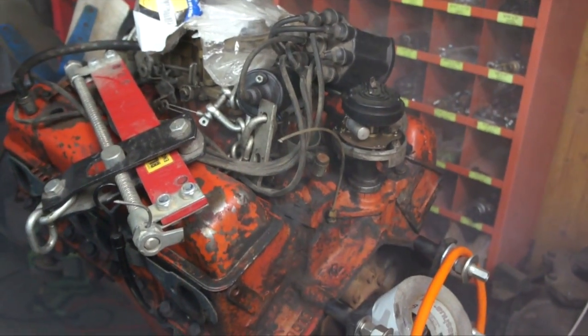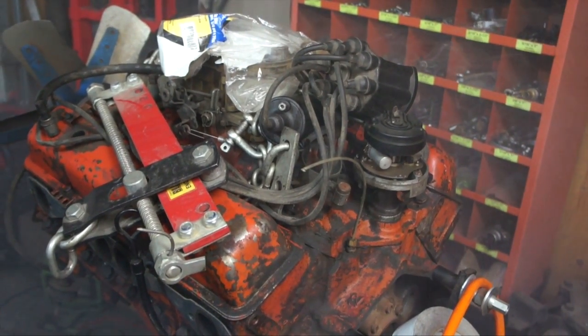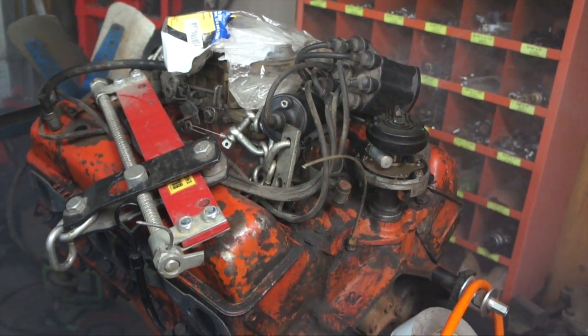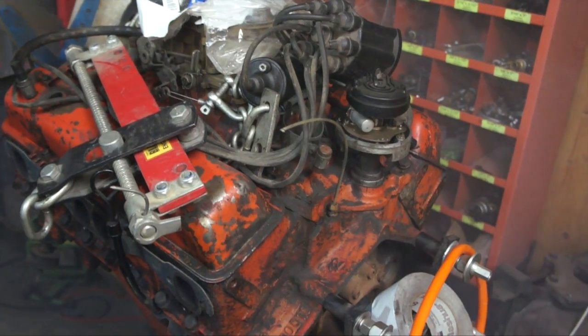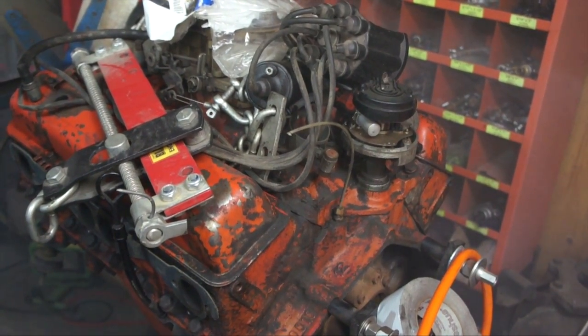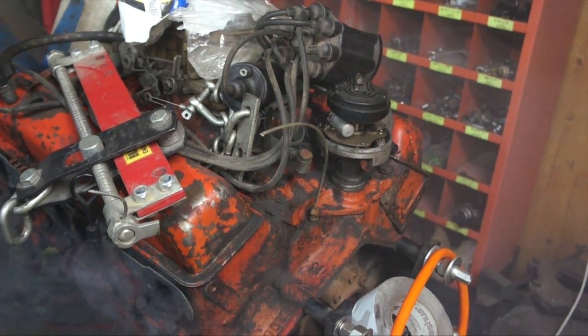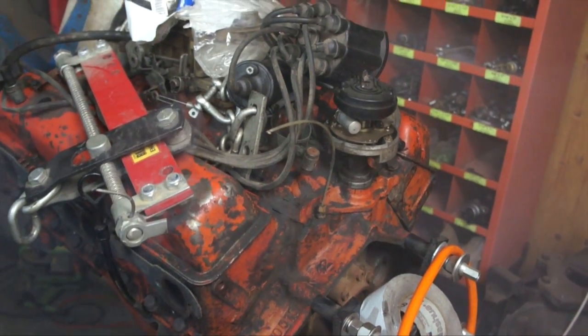This came in handy when I was working on my BMW E46, because I had a secondary lean code on bank one and two. My fuel trims were way out and the engine was running like crap — I couldn't figure out what was going on. It turned out that when I installed the valve cover, it got rolled over in a section, letting in a ton of unmetered air, which triggered the code and made the engine run richer because it thought it was running lean.